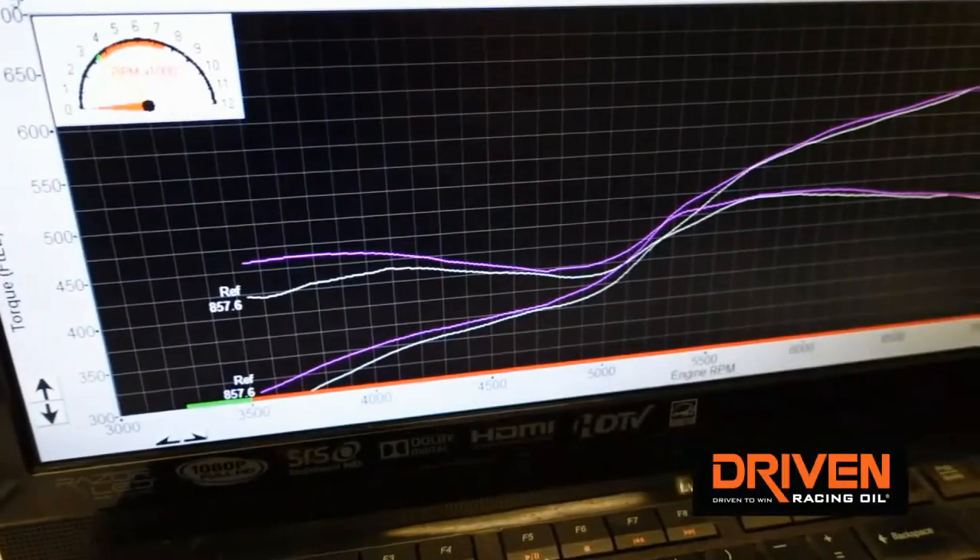It's not an easily predictable slope, and I think that's the hardest part to get your head around. It took several hours of continuous tuning, programming, and uploading. But by the time we got done, it made a huge improvement in the way the engine ran — just on that one data point of CA50. At 3,600 RPM, we found 39 foot pounds of torque just by optimizing timing.